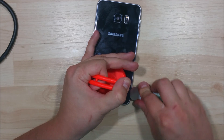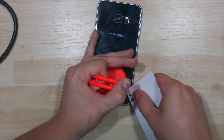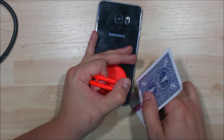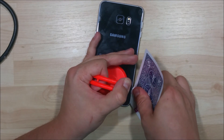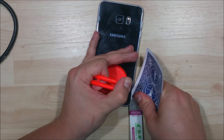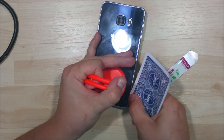The paint on this thing is really easy to take off — I just dinged it a little bit there. So you want to be pretty careful. If you can open this with just a plastic tool, more power to you, that's what I would do. But I've never been successful enough to get it started without a metal tool more than just a couple of times. Especially on these bigger phones, they seem like they have more adhesive across the back.